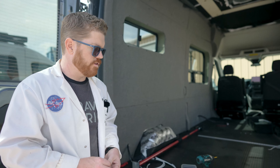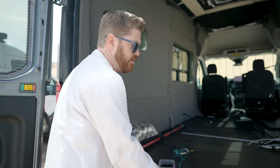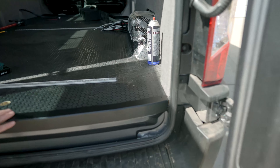We're getting started here at the back of the van and before I install this I wanted to point out the screws that we're going to be using. We're using a three quarter inch wood screw with a modified truss head — it's the same kind of screw that we use for our wall kit. So we're just going to take our rear piece of trim, set it in place, and make sure we're centered. We do give you a little bit of room side to side.